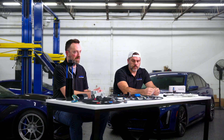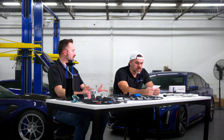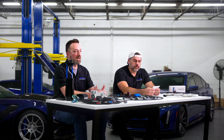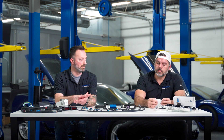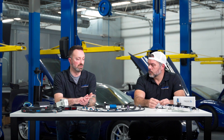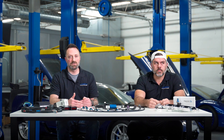There's boost by front wheel speed. We use front wheel speed because if you're doing a big gnarly burnout, it kind of defeats the purpose. In GM land it's referred to as undriven wheel speed — undriven up front, driven in the back. We have boost by gear, so if you want to modify by gear whether it's an automatic or a manual, you can do that. We've got boost by drive mode: your default is always touring mode, and if you put it into sport, track, or even snow/ice, you can have different modifiers to change that relationship.